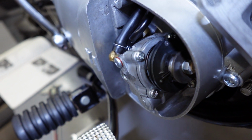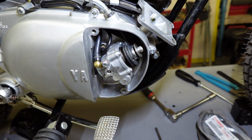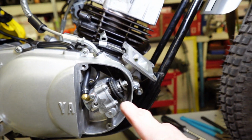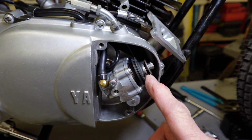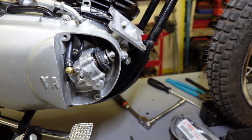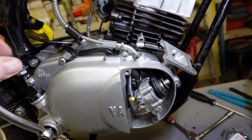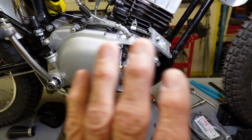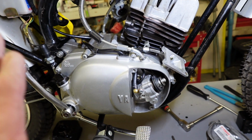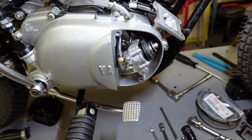But I think that's where we're at on this, is we're just going to have to work on these cables a little bit before we do anything. The thing with these, when you're adjusting these pumps, is that the cables are adjusted first, and then you adjust the pump, except for an initial check of the clearance between the pump washer and the pulley. If that one's okay, in this case this one is, then you proceed on to cable adjustment. So we're going to go through all that, but the number one thing is the cables are first. So just don't play around with the pump or anything like that if you can't adjust the cables with the proper procedure. If you can't do that, you have no reason to be adjusting the pump, because it's not going to be right.